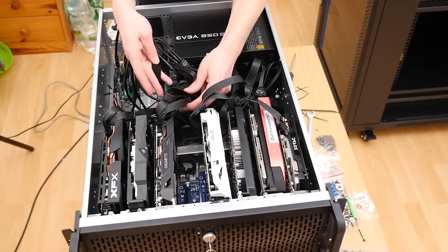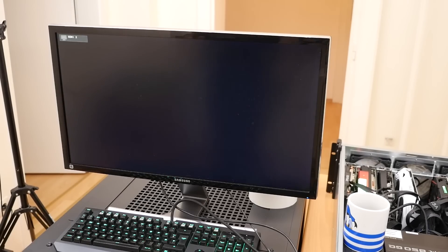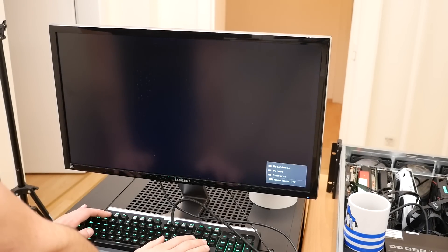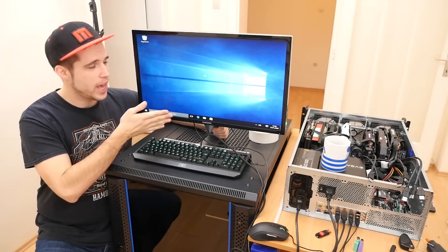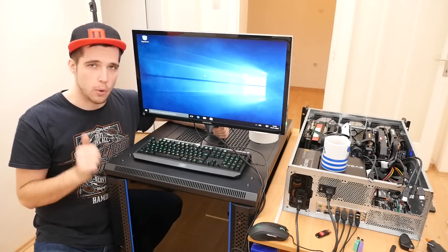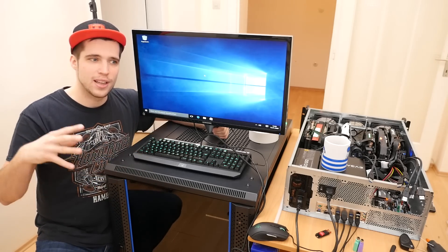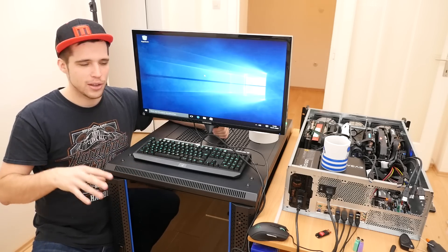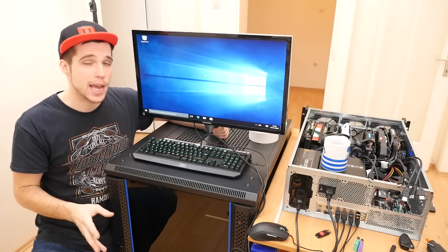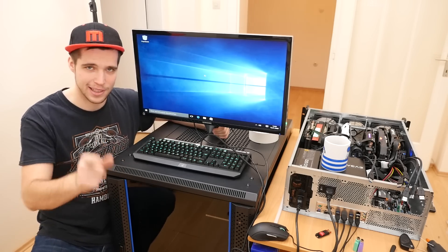After all the GPUs are in, it's time to check all the cables and connect the power cables to the GPUs, risers, and motherboard. First test — and BOOM — no HDMI output. But that's completely normal. First you need to install Windows with one GPU only, because if you try to start with all eight connected you will probably not be able to boot. The rig is up and running with a fresh installation of Windows, but it's currently running on only one GPU. If you install all the GPUs without modifying the BIOS and adjusting Windows settings, it won't boot — the keyboard doesn't work and Windows won't load. It's way easier with Linux, but for our tests we want to use Windows, so we have to get into the BIOS and adjust some settings.